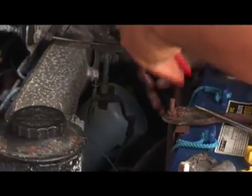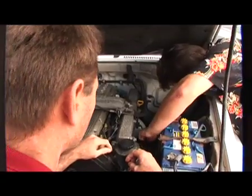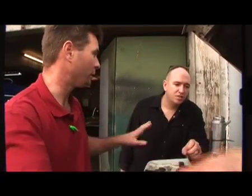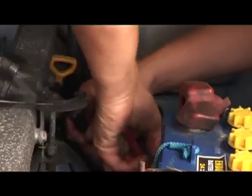I'm interested in fuels that would get us off the dependence on normal fossil fuel. So these metal shavings used in this — are these things that would be commonly found at a low cost? Yes, basically it's pretty cheap. The line that we've taken off is the one that comes directly from the fuel tank in the back of the vehicle, runs straight up to the front and goes straight into the injector pump, which then disperses and supplies it out to the injectors.